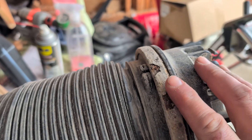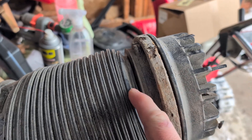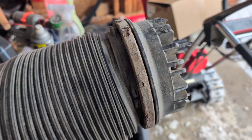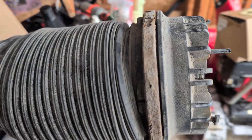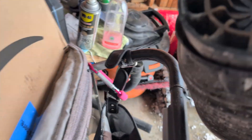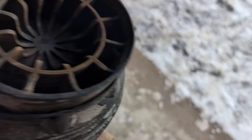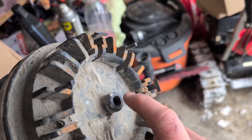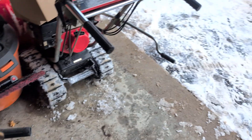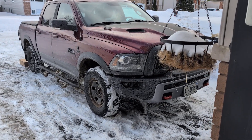These are really crusty and there's an inner ring inside when you extend it out — exact same condition. So stupid simple. Just make sure that indicator is facing the front and straight, the clips are engaged, and your o-ring is clean when you put it in the new fitting. Then start her up and get the compressor going.